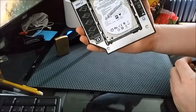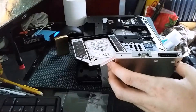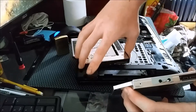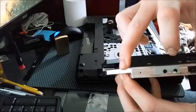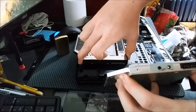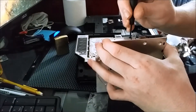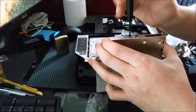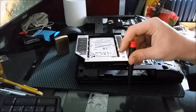As you can see, the hard drive is not going to move out of there, which is nice because you don't want your hard drive moving around inside that bay. You're going to need to take this piece off right here and put it onto your hard drive bay, which has holes for it. Just get a small screwdriver, make sure you don't strip the screws, and keep them separate from any other screws you have lying around.